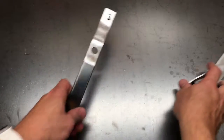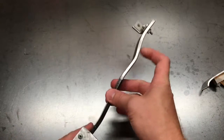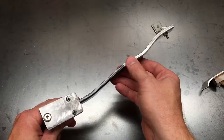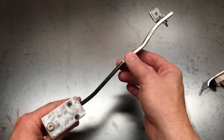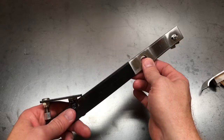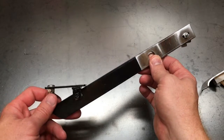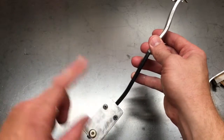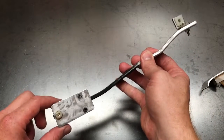The first one I made was out of steel. I measured the interior pretty close and tried to bend the contour to match the sheet metal in the car relatively close, so that when it's mounted in the car you have more clearance between the brake pedal. I'm using an SN95 pedal box — a factory Mustang pedal box — so you have more room at the brake and you're not reaching for the brake, snapping the gas, and creating a safety issue.